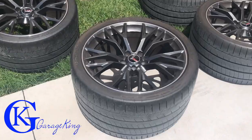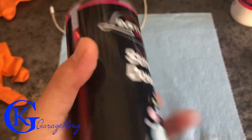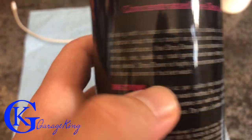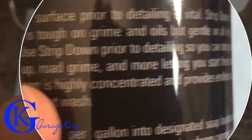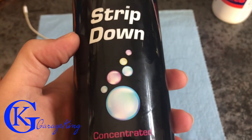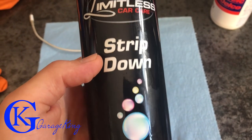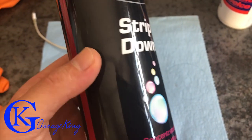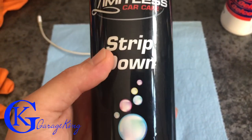Wheels are off and it's time to wash them. The soap I'm going to use is a strip-down soap — it's a pre-detail wash that strips away old wax, oils, buildup, road grime and more. You want to make sure you're not using any shampoo that provides a wax, because then you'd be applying the ceramic semi-permanent coat on top of it. I just wanted something that wouldn't leave anything behind.